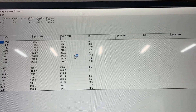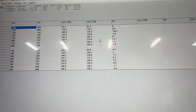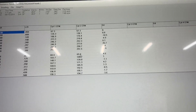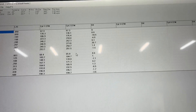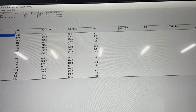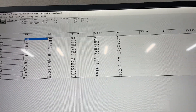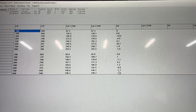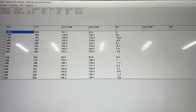I actually thought it was going to lose everywhere, but there are only a few spots where it loses, at least on the intake side. If we look at the exhaust, it's different — it's pretty much about the same. That number at 100 lift I think I made a mistake, so ignore that, but the rest is down which is normal, and there's no port work done. So, valve job: if someone says cutting to a larger valve is going to hurt flow — most places yes, but at peak lift it helped. We'll talk about how we're going to do some more work in the next video. Thanks.